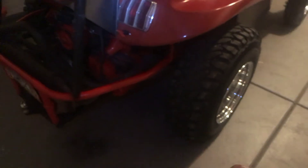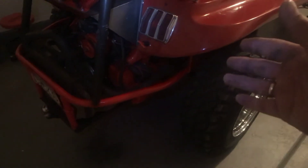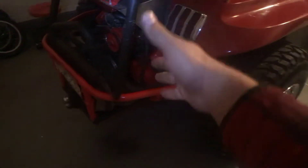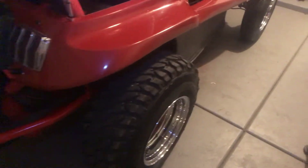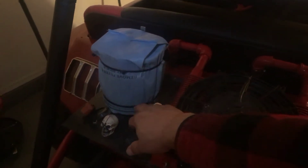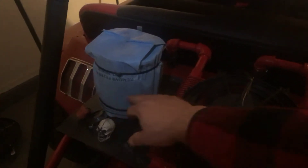Check it within 30 seconds or you'll get a fake reading that you're over full. Make sure the oil cooler is full and you've got oil in the oil pan. Run the engine, shut it off, and walk back and check the oil right away. When putting on the filter covers, just very lightly zip tie them — don't crush them, they're very soft.